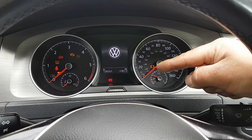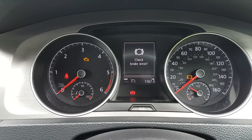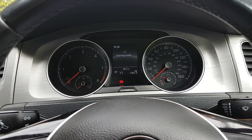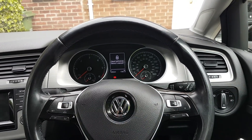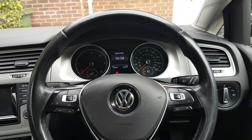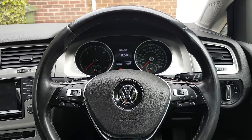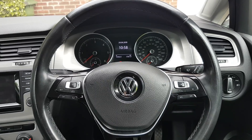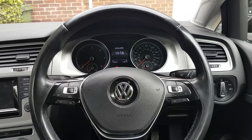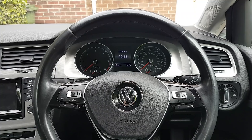The next issue we're going to sort is the warning light in there — 'Check Brake Wear.' So most likely this is going to be a brake job. We'll be changing the front brake pads and sensor. As I said on the other video, the rear brake pads are low but still okay for a few thousand miles. The front ones are indeed low, so let's crack on and get these brake pads replaced.